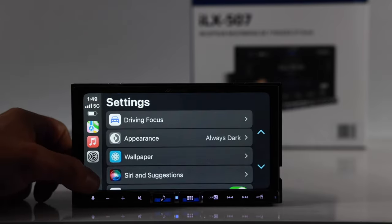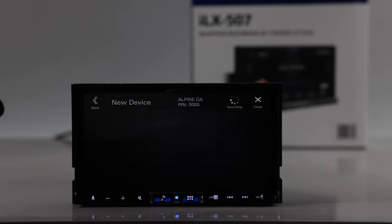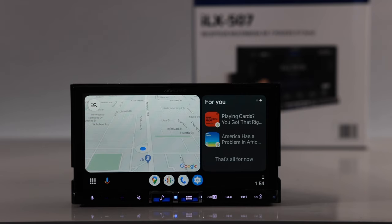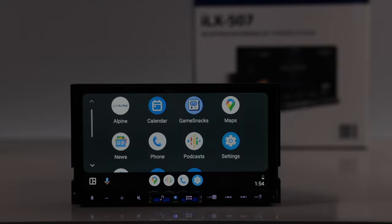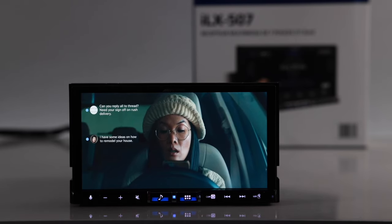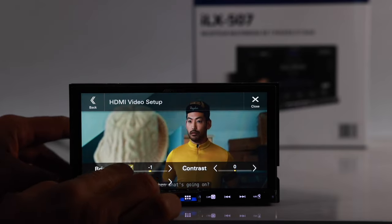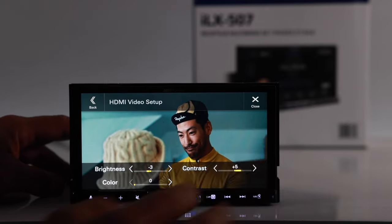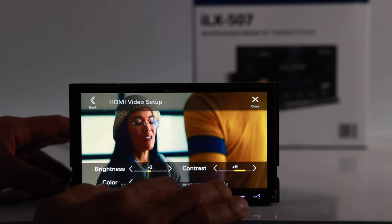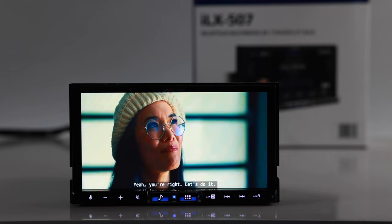For wireless Android Auto on the Alpine, go to Quick Setup > Device List, add a new device, search for Alpine DA on your phone, and Android Auto connects — very easy, piece of cake. The HDMI input delivers a very sharp image immediately thanks to the high pixel count. Unlike the camera input, you can adjust brightness and contrast while the video is playing, making it easy to dial in the picture. After pulling up contrast and adding a touch of color, the result is vivid and sharp.